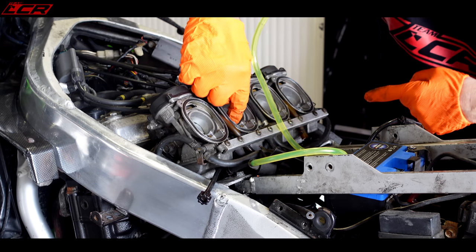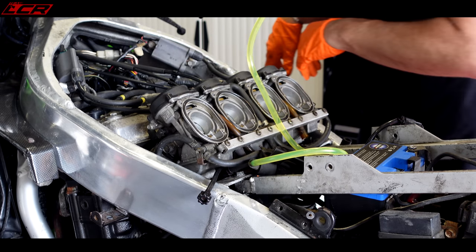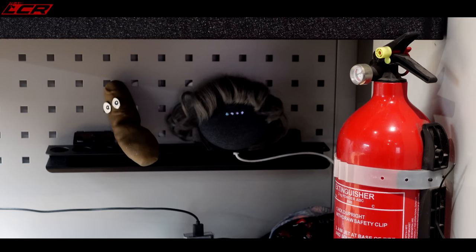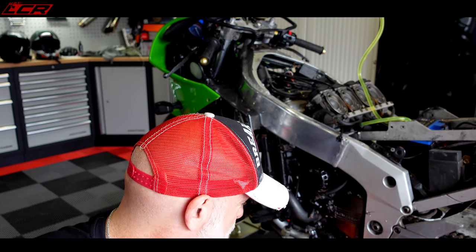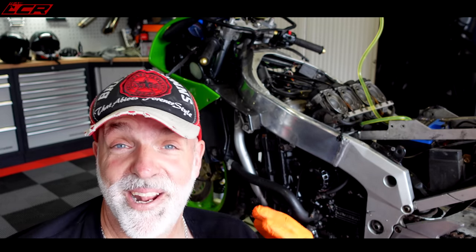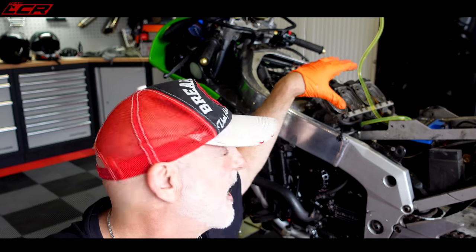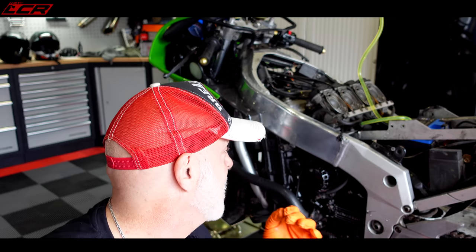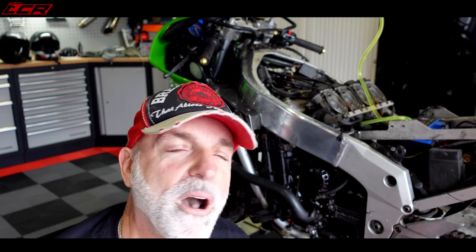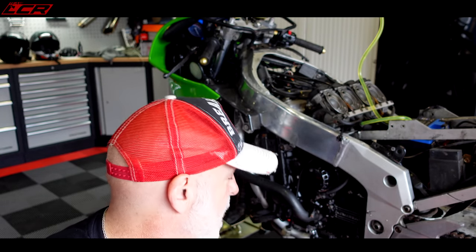It runs! It's running on three because I can see there's no fuel in this carb at all - the others are flooded with loads of fuel. The carbs need sorting. There's fuel everywhere. Can you move me out of here before I'm engulfed in flames? It only bloody works! There's fuel dripping everywhere, fuel pissing out one of the carbs because it's only running on three - that's why it's so lumpy and sounds dreadful. The carbs aren't right, but it started. It's actually fired for the first time in ten years, maybe more.